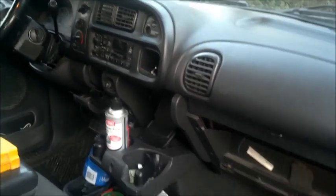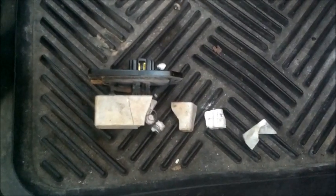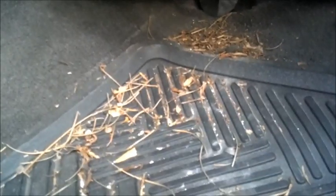I've already pulled the old one out — you can see it basically disintegrated, so I'm guessing that's definitely what was causing my problem. You can see all the crap that came out when I pulled it out. My truck's actually usually pretty clean, so that all came out from under the dash. I removed the glove box just to get access, and you can see up under here — it's kind of dark — but that's the electrical connection right there that connects to the resistor, and it mounts right up in there.